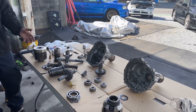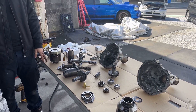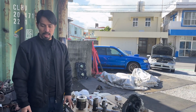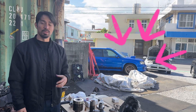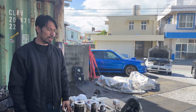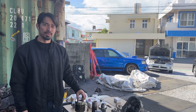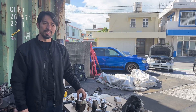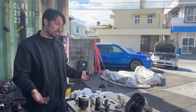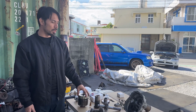I asked that question because I had a Forester STI that was non-DCCD and wondered if I had to buy a whole other transmission versus just converting. I understand the desire, but my honest opinion is still: sell your non-DCCD 6-speed and buy a DCCD 6-speed. Because to drill that hole and all — these parts sold separately are still expensive, so at the end of the day I don't know if you're saving that much money.